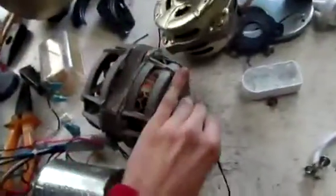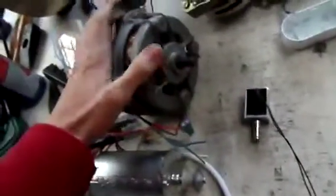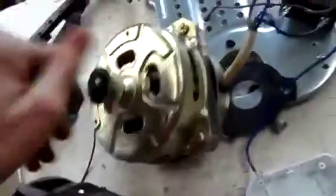Here you go. These are what you'd normally find. These are both out of Breville's of different ages. This one was a fairly newer model. As you can tell, it's a lightweight aluminium housing, and they're not much bigger than a modern top-load washing machine motor. They're around the same size, and they do the same job as that one does. That's a fairly earlier one. It's got the cadmium plated steel housing, run cap, which these things need. This one hasn't got it, but I'll work on getting one for it. But yeah, never seen anything like that before.